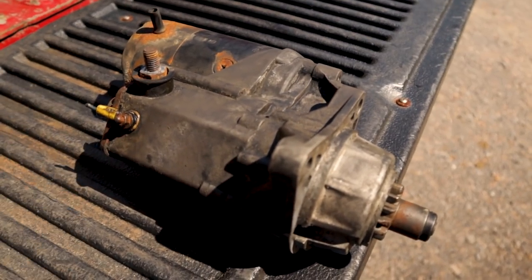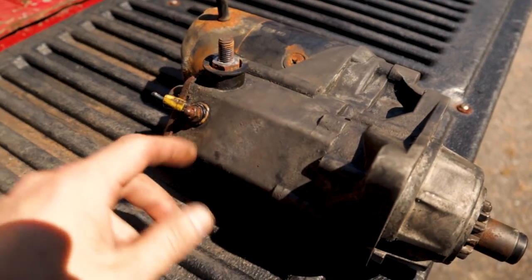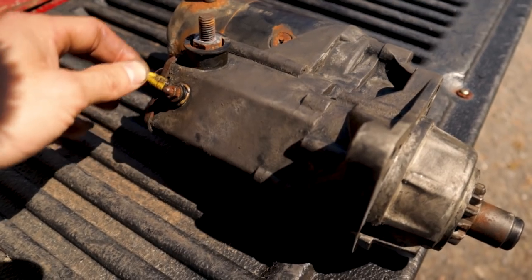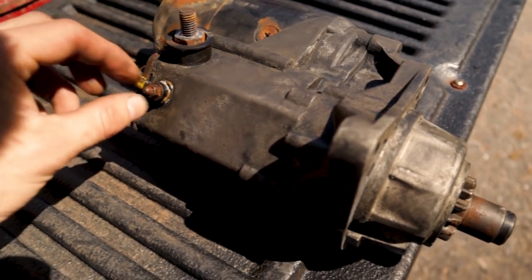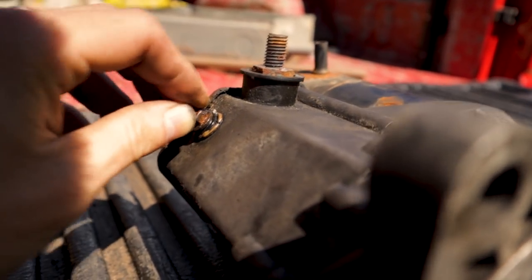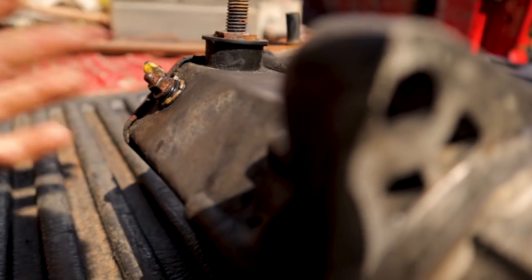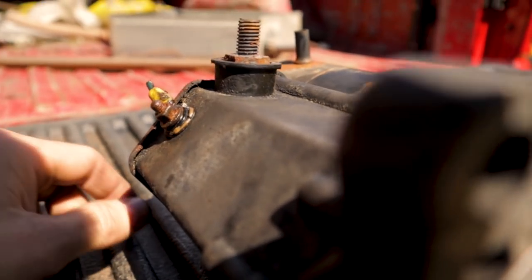Here's just another quick look at the old starter that we pulled out from the 24 valve. As you guys can see, this stud right here is just completely loose and honestly about to fall off. I wouldn't be surprised if this is our main problem. Look at that — it's actually pulling right out from the actual body of the starter as I lift up on it. It's supposed to be attached down inside there, nice and snug and sealed up from any weather and all that. But as you can see, this one is just no bueno.